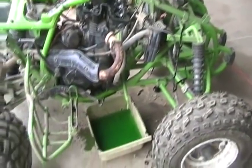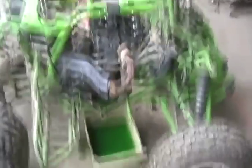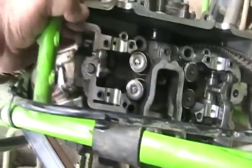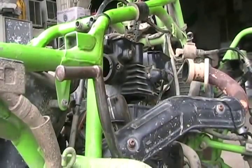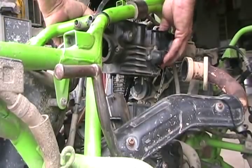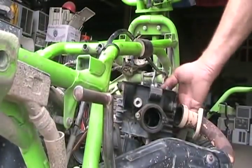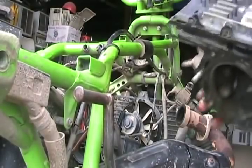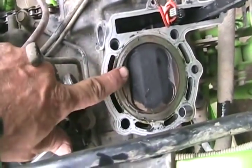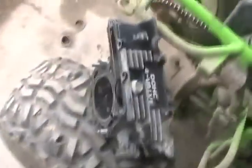You can really see how the cam has just been chewed right out of that sucker. But lo and behold, that other cam looks really nice — not perfect, but good enough. I'll remove the other cam, tie up the chain, and get out the rest of those head bolts. Now I know where Kawasaki Green comes from — the green coolant that drains out of these machines. All the bolts are out and the head is ready to lift off. The timing chain is tied up — it slips right out. This accident to the engine happened a long time ago, so you can't see any fresh clean dent marks on the piston where the valves hit it. That'll show you how to test for bent valves.